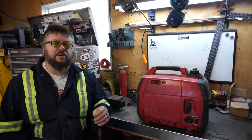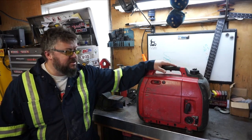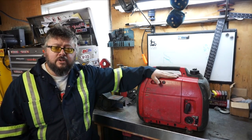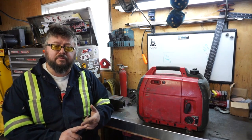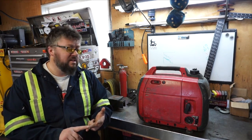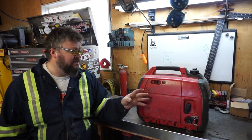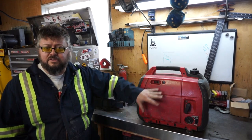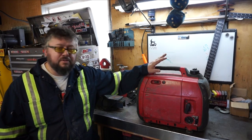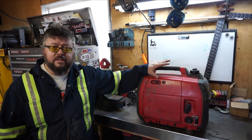Welcome to today's video. This is the start of a few videos to come. This is a Honda EU 2000i generator. There are definitely a few things we have to do to it: one is a timing belt for sure, possibly valve seals and piston rings. There's also a rattle inside when it's running that we have to figure out. As you can tell by looking at it, this thing has been through the war — it has been well used, so I think an overhaul is needed.